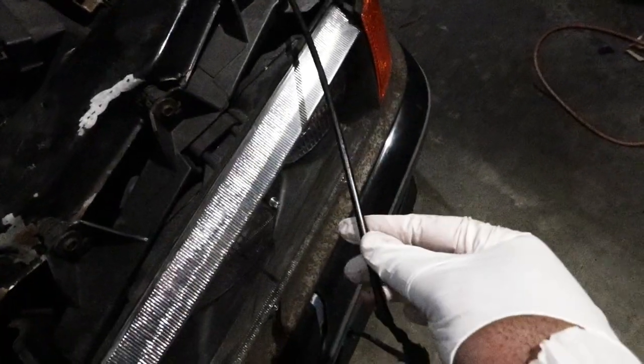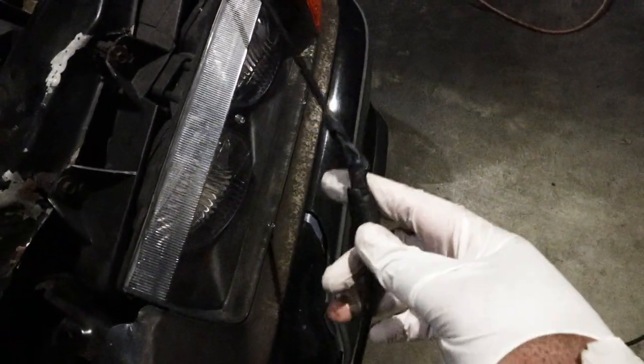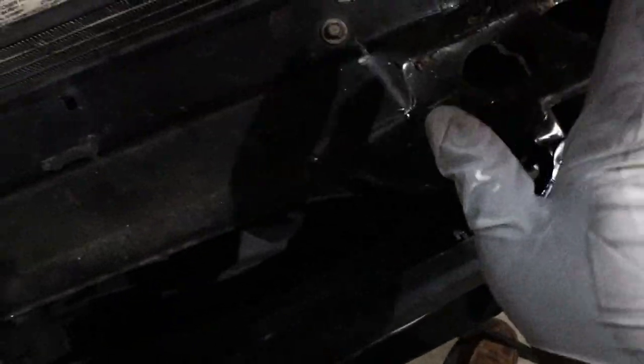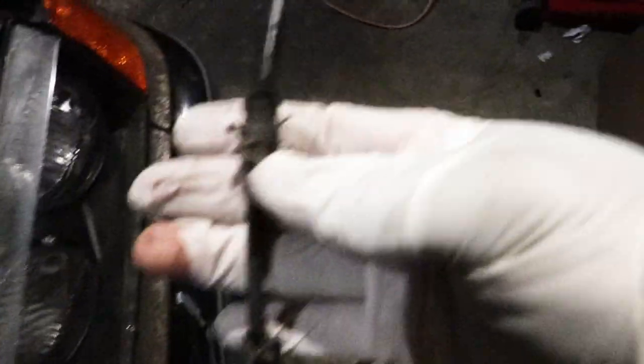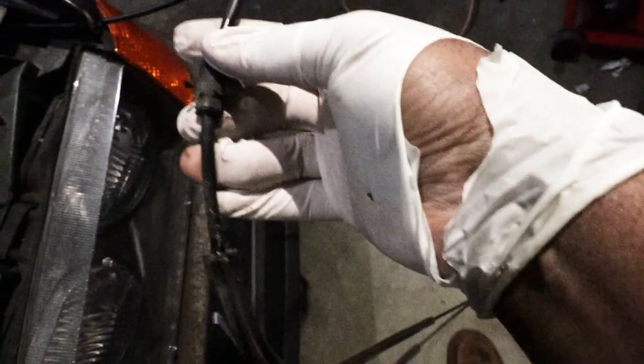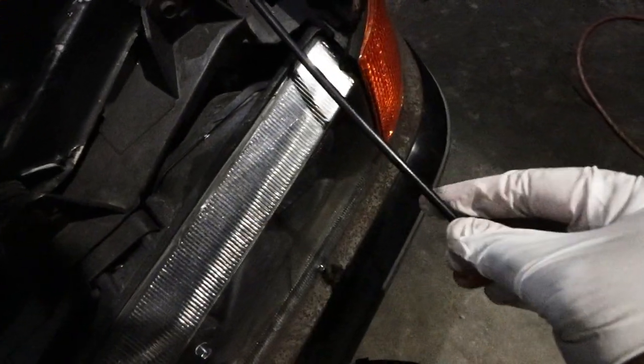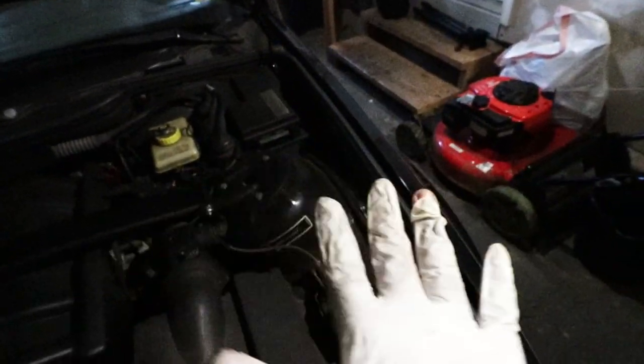I am done pulling. Here's the new cable right here, and it's still attached to the old cable. I put some tape and a zip-tie inside just to make sure that they don't separate. Here's the old cable that is damaged. Once you cut the grommet, it's going to go in the hole that is inside the footwell area. Then all you do is go in there, push from inside, come to the front, and pull. The grommet portion is now stuck on the hole over there and it's not coming out — that's exactly how you do it. Let me go ahead and reinstall this piece right here.